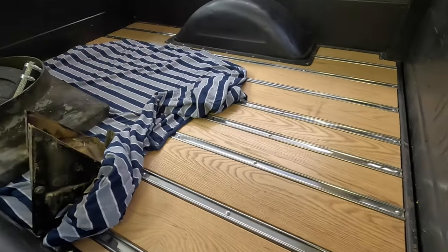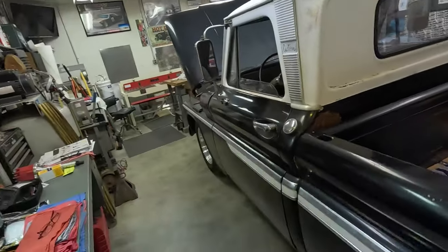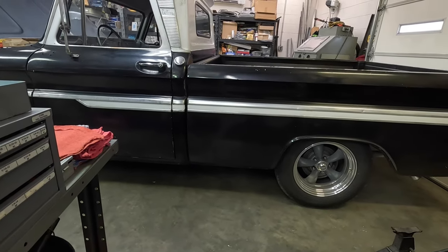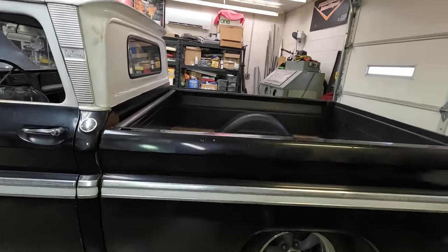Dad polished the stainless a little bit and got all that put in. We did the same thing to this truck that we did on the 55 truck — we had to raise the front of the bed to get the body lines to match up right, because the bed was sitting so far down in the front. We got all that lined out and then rebuilt the drum brakes in the back. This was a pretty big project — quite a bit of time — but really excited for you guys to see this truck and see some of the stuff that we do to it.